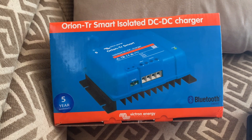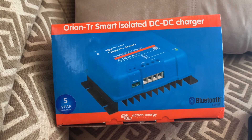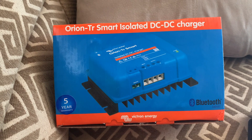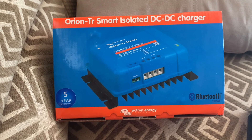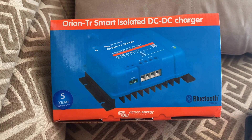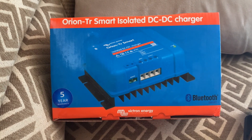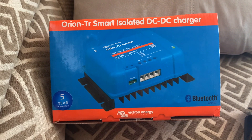The challenge is, if you're going to lithium iron phosphate batteries — or as they're called, LiFePO4 batteries — when you put them in and run them down, when you connect your RV up to your tow vehicle, your car or truck, what it's going to do is just say send me all the current you can give me, almost like a direct short. It'll just suck everything out of your alternator. Alternators are really designed — like 100-amp alternators — to do 100 amps when the RPMs are 4,000 or 5,000 driving down the road. But when you're idling, it's not moving enough air through the little fan on the alternator to keep it cool, and people have their alternators burn up.